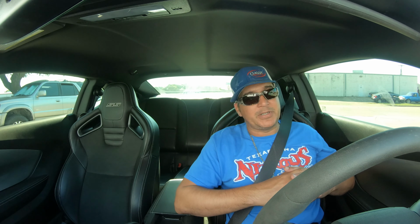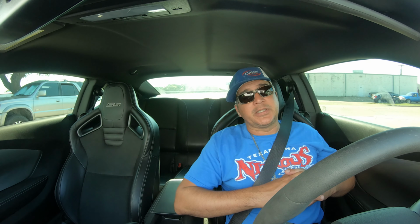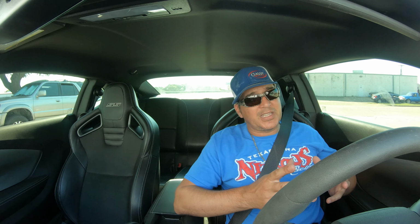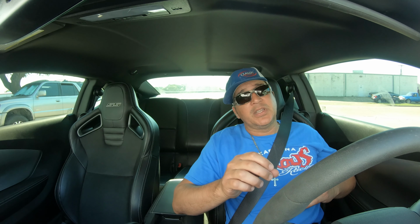You go to Classic Chevrolet, you can buy yourself one of the new supercharged ones. It makes a little bit more power. If you're not in that big baller price range where you can spend that kind of money, and they're beautiful cars, I'm not taking nothing away from them, they're great, they are expensive though. Not all of us got that kind of money. But if you come and get something like this and you save a lot, you add a little Whipple, you add a little fuel system, you can be in the 650 out of cam, 650, 675, maybe 700 range. You're gonna have a badass little hot rod for cheap money.